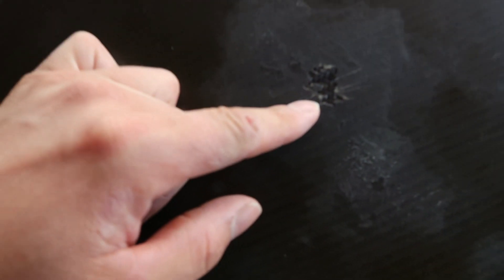We can't just clear coat over exposed carbon fiber - we're going to be repairing that. We do need it wet sanded and we're going to be giving it a fresh coat of clear coat, all in this video hopefully. Starting off I'd really like to just get this thing wet sanded, dry it, and then move forward with how we're going to fix that crack.